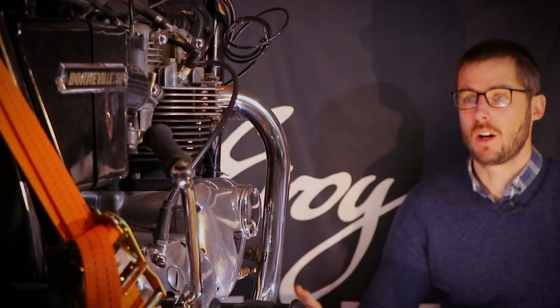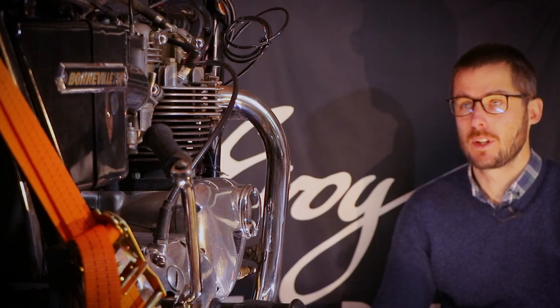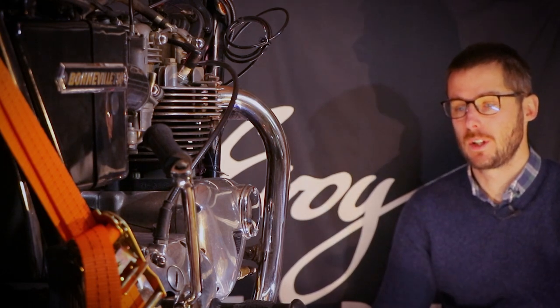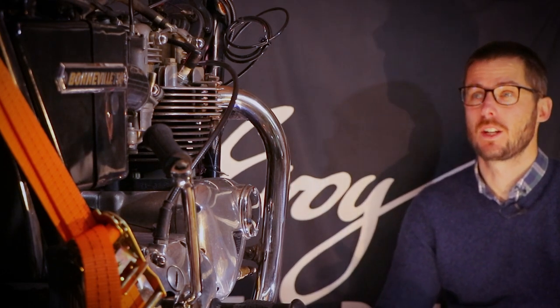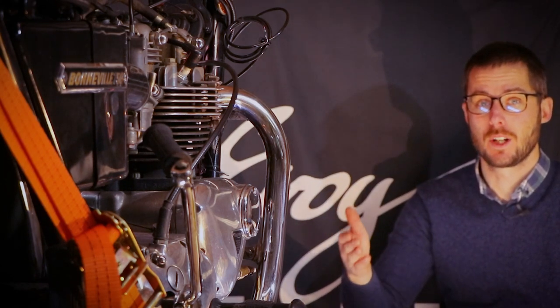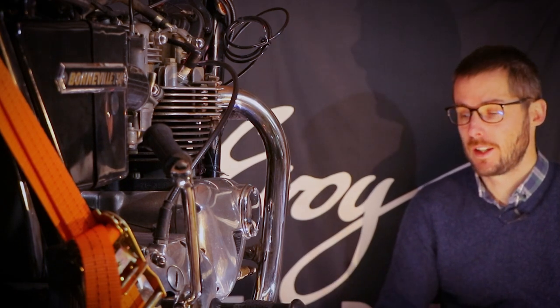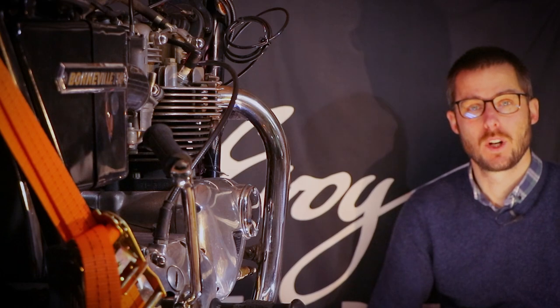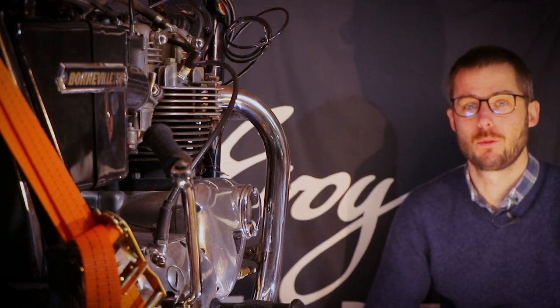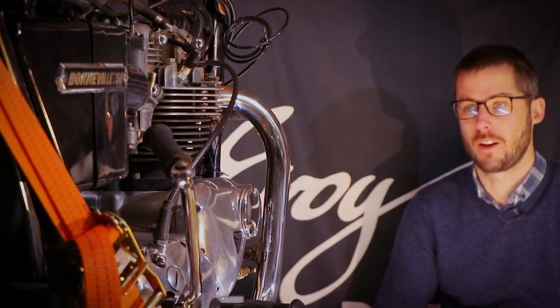So here we are. The front fork has been completely dismantled, and next step is just to assess what needs to be replaced. So I'm thinking of the steering head bearings. We've come so far, might as well do it now. They are in a pitiful shape. The front wheel bearings as well, and might as well do the rear wheel bearings while we're at it. We'll come to that at a later part of the episode.